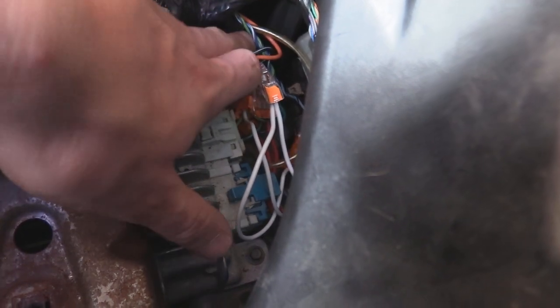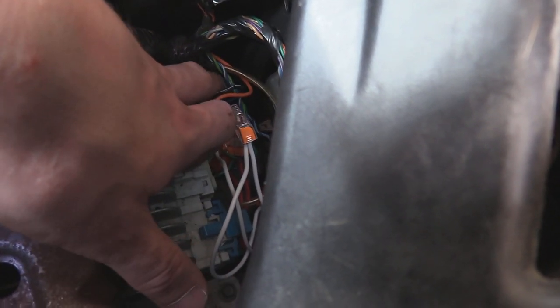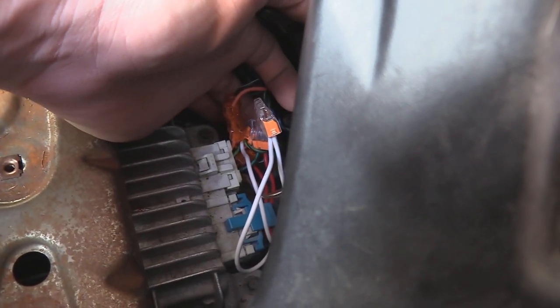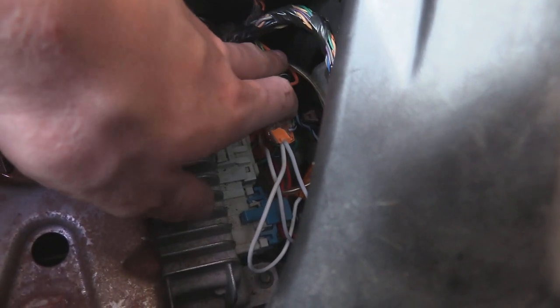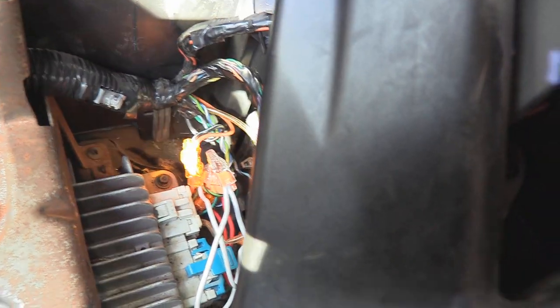The rest of them — the two sets that are braided together with the green and blue wires — those are your positive and negative for the right and left side of the sub. Those just have to be hooked up coming out of the amp. So if you want to disconnect the factory sub, just cut it at the harness and it won't power or turn on your factory sub.